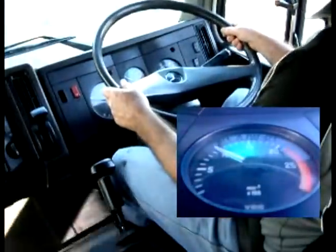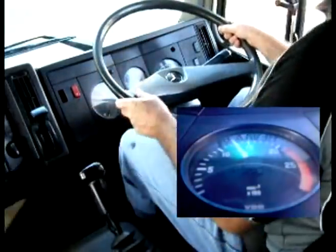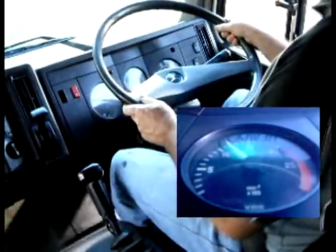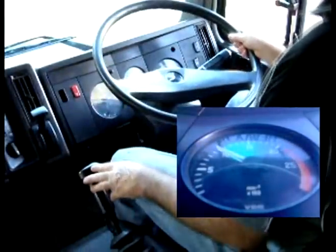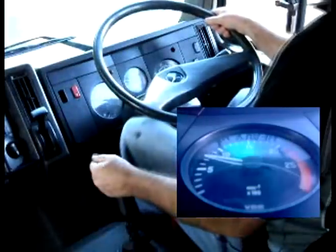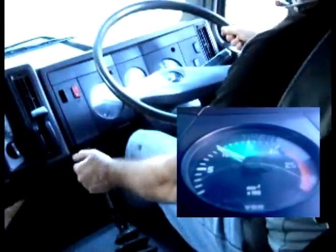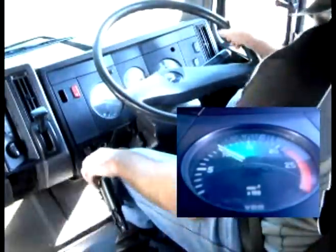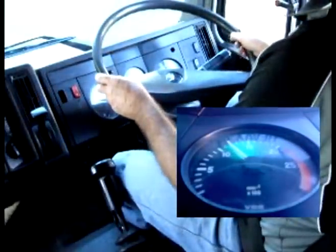Two gears back, 800 RPM. So we'll go from 7 overdrive to 5 overdrive. This time we're going to go from 5 overdrive back to 3 direct — so it's 2.5 gears. You've got to allow 100 RPM for the splitter, so we've got to slow down to 700 RPM. Move the splitter back, touching out of gear, clutch up. Rev to your 1500. Miss your gear — also got to pull my splitter down. But you never force the gear; if you feel something's wrong, don't keep pushing on the gear stick. Work out what the problem is, re-rev it, sort them out.